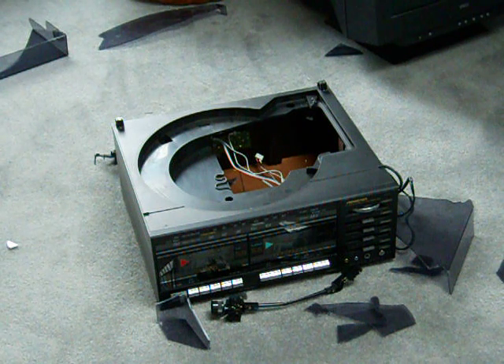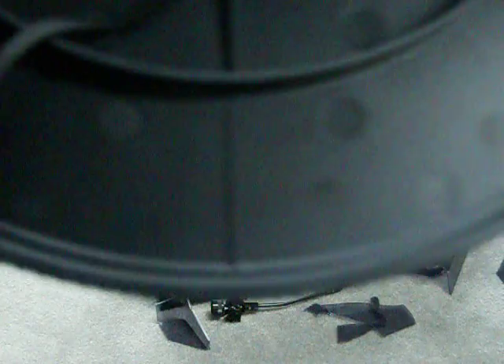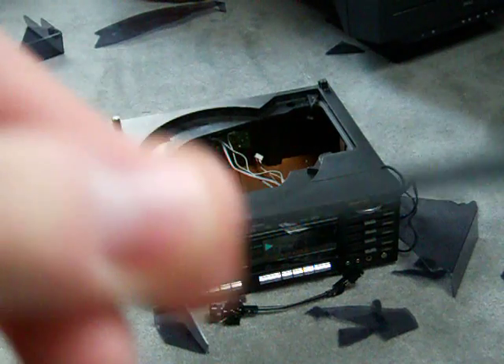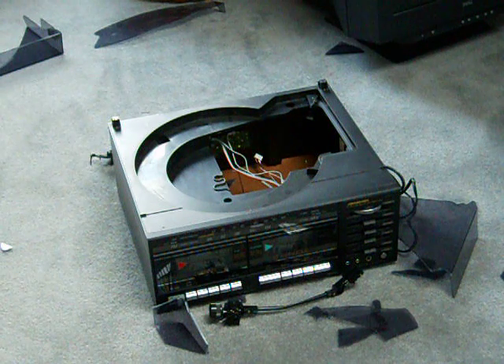Here's a closer look at the mechanism. You've got your standard cheap all-plastic platter with the built-in 45 adapter, which is pretty cool. Your speed adjustment right here — this was a semi-automatic turntable. That was the motor, and here's the belt in all of its stretched-out glory, hopefully showing up on the camera. That's the belt drive — or it was. There are no trimmers or anything for the 33 or 45 speeds, it's just generic, right in there.